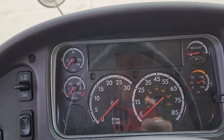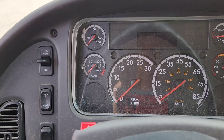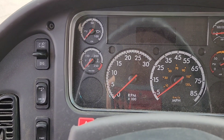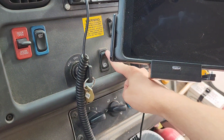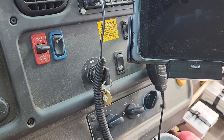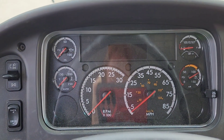So basically you have the option of doing your forced regen or taking it to a workshop and having them do a forced regen with a computer. Otherwise you have to call for service and you might have to be towed, because if your stop engine light is on it's likely that this switch is not going to do anything for you. So the goal is to do the forced regen when it's safe, before that becomes a problem.